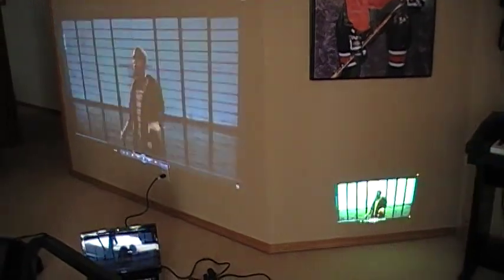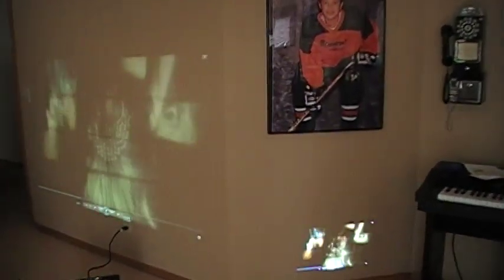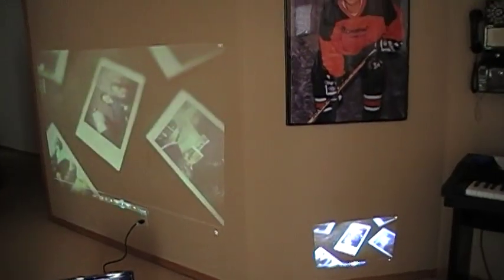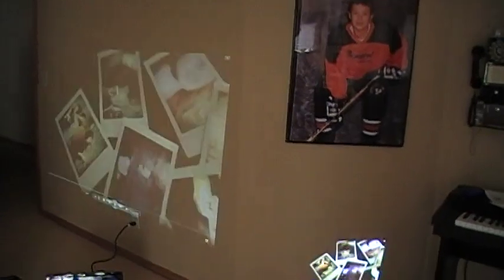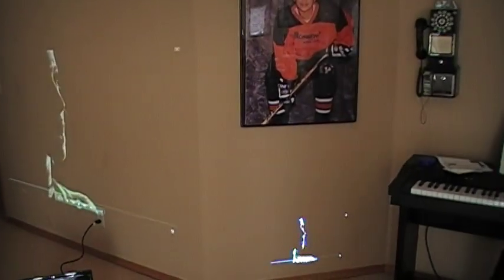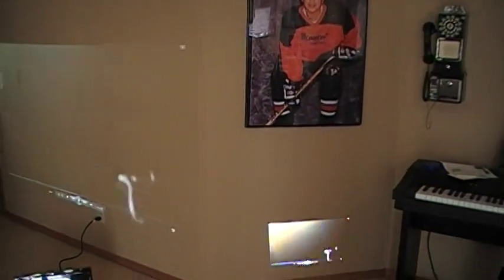When I'm talking about DJing school dances and I use rear projection, I don't have to have my screen sitting 25 feet off the wall. I can have them almost just five feet off the wall — just enough room for that projector to get in behind there to project — and it makes a huge image, partly due to that bubble on the front of the lens. I'm not saying that long throw is a bad thing. It's definitely helpful in a home theater application if you're projecting from behind people, or any situation where you're going to be further away from the screen. Short throw is helpful in situations like mine where you're trying to DJ, or if you're just trying to make a bigger image because you can't always back up and you don't have a lot of space.